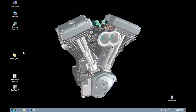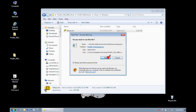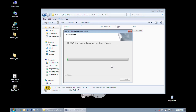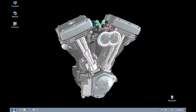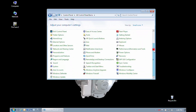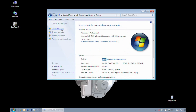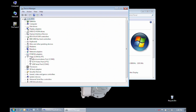Now let's install the driver for your USB to serial converter. We'll follow the same sequence: unzip the driver, then click the executable. Now that we've installed the driver for the USB to serial adapter, we need to know which communications port we're communicating on. Let's go back to Control Panel, remembering to select small or large icons, then scroll down to System and go back to Device Manager. In Device Manager, go down to Ports (COM and LPT). Opening this up, you will be able to see your USB to serial converter and which communications port it is emulating. If you're using a built-in comm port on the computer, you will also be able to see which port it has here. Remember this port number and close the boxes.